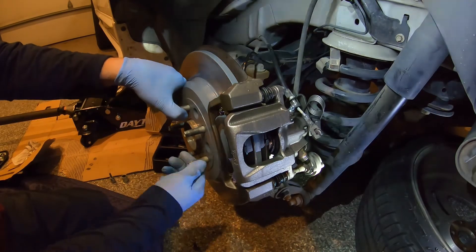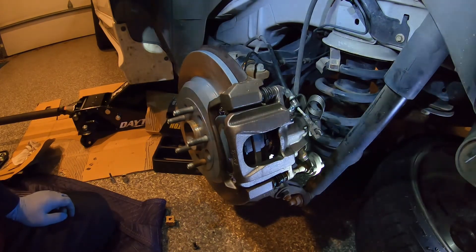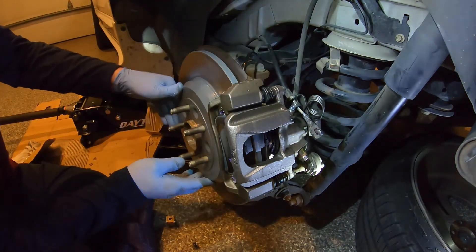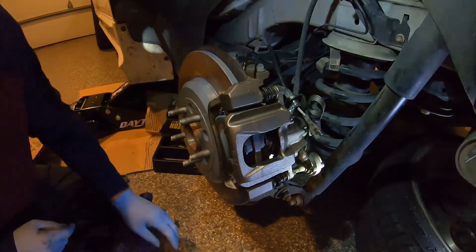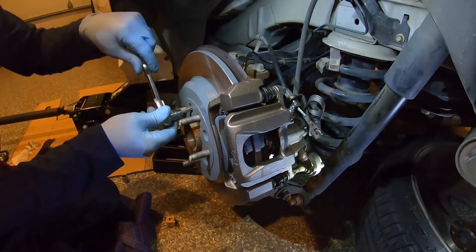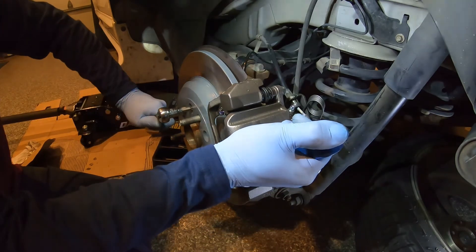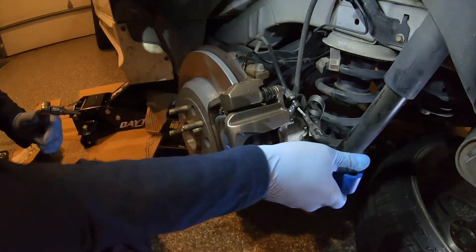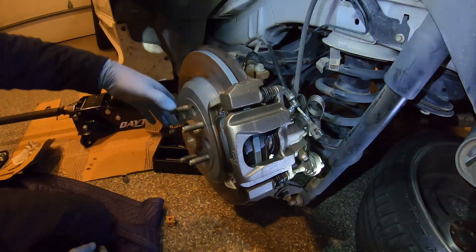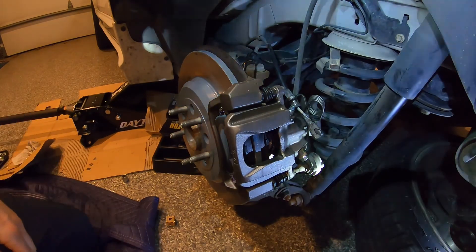You should be able to spin your rotor. That's how you install and replace your rear brake rotors and calipers. One last thing — remember the T40, we need to tighten that. Now that your pad is on there, wedge something down in there to prevent the rotor from turning and give that a good crank. And that's it guys — hopefully this video helped you out, I appreciate you guys watching, thanks again.